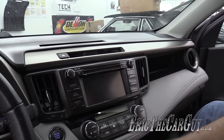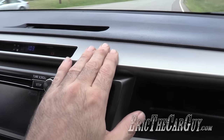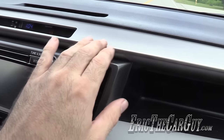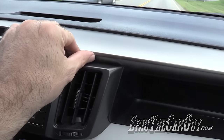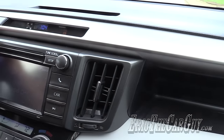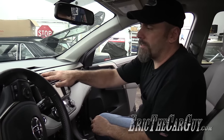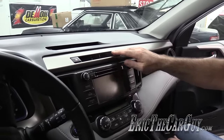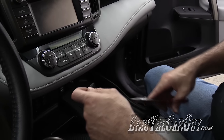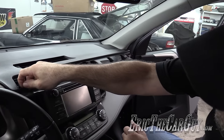Let's go for a drive test. I'm still hearing a little bit of the noise — it hasn't quite left us yet. Especially when I pull down, so that means I want to push up. This is part of how you solve these: if you're pulling down and you hear the noise, you want to wedge it so it goes up. We've made progress, we're on the right track, just need a little bit more — over here in particular. It's back to the shop. I'm going to try a few more pieces to lock it in, and I might even put something right here. Nice thing about this tape is you can cut it to size.